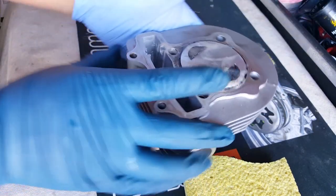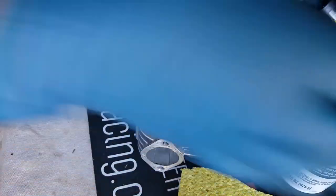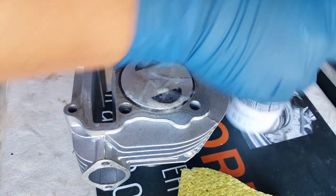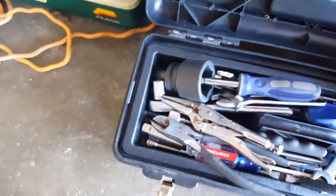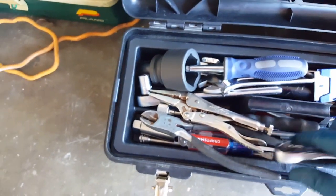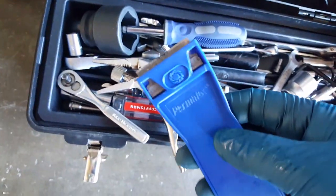In the meantime, what we can do is take out the CVT cover — hopefully this engine cleaner will do a little more magic here. Again, you can just pick this up at the auto parts store. Let's get started on removing the CVT cover here. It's going to take an 8-millimeter with an extension. Remember the cardboard box I made — we'll still use that. Even though we're going to replace all our bolts anyway, it's just good practice.